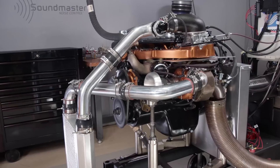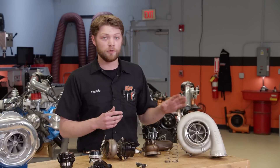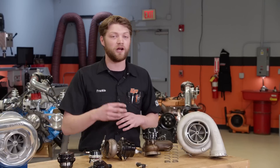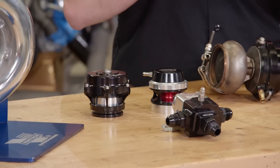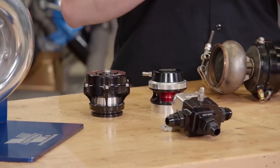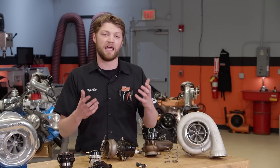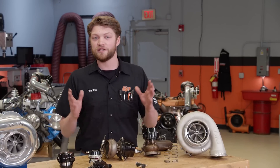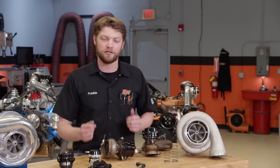The solenoids allow you to apply pressure on the top and bottom of the spring and control precisely when that valve opens at what boost level you want. Now, if you're under boost and you close the throttle blades very quickly, that turbo is still spinning at a very high rate of speed — usually over 100,000 RPM — so it is going to still try to force air in there and it has nowhere to go. That's where you have a blow-off valve in the intake track, which acts a lot like a bypass valve. It is referenced off vacuum underneath the throttle blades. When it sees vacuum, it opens up, takes all that boost, and lets it out into the atmosphere so that it can't harm your engine. It's pretty complicated, but once it's all working correctly, it works in harmony and gets you exactly the same results.